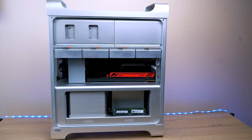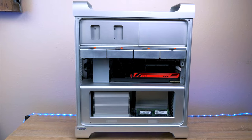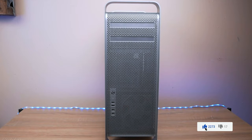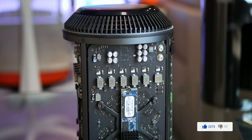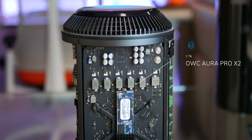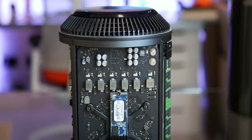This machine is not as easily upgradable as the previous 2009 generation; it has a different approach, but all the internal components are user upgradable. And thinking about the 2009 Mac Pro, in the next video we'll compare it with this machine, so stay tuned for that. In this video we're going to upgrade the base model to the maximum 12-core CPU, 64GB RAM and 1TB SSD. We'll go deep into benchmarking before and after, and we'll see if it's worth the price.